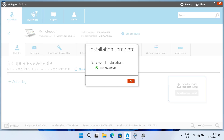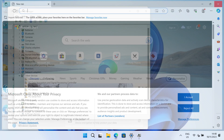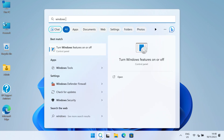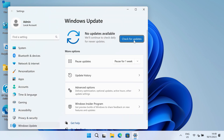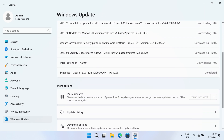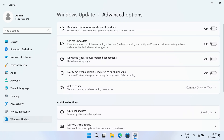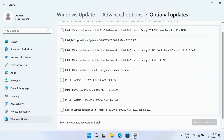What we want to do — say OK to that. We actually want to go back to the web address and download and install the chipset drivers. Actually, what we're going to do first is run Windows Update and let Windows take care of it. So we're going to click on check for updates. And once it comes back with some, you can scroll down to advanced options and see what optional updates we've got. Looking down the bottom under additional options, we've got optional updates — it says nine available. So we do want to install a lot of this.